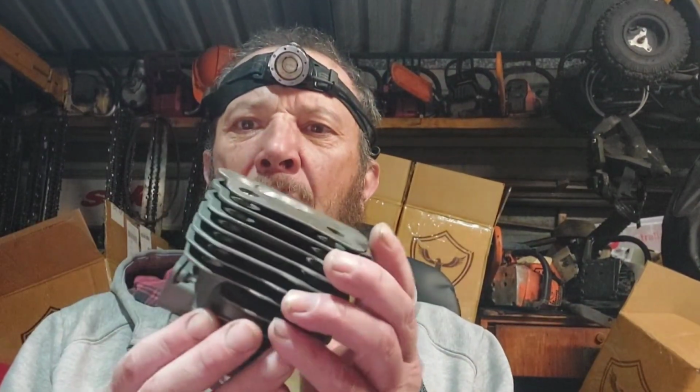So first part comes out, blows the exhaust out because it's higher, blows out the exhaust behind like that. Then the boost port opens up and starts shooting towards the exhaust. So it blows straight to the exhaust, but then the lower part of the transfer, which is the last part, blows back against the boost port and should blow all back up to the top of the cylinder, up high. So that's the best way to do it.